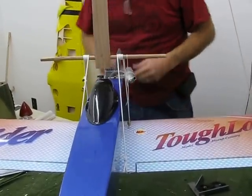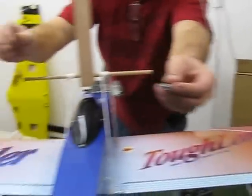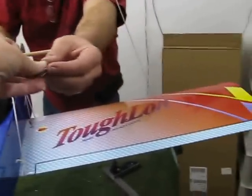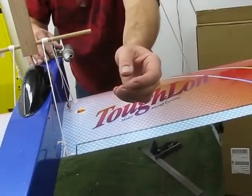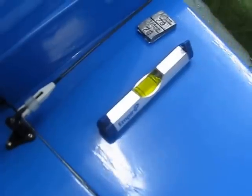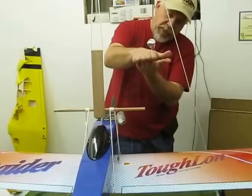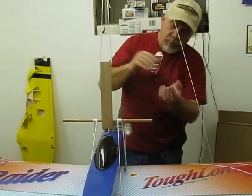What we're going to do is have my wife put a level on the tail, and then we're going to add a couple of chunks of weight to the tail to simulate it being tail heavy. When you do this, you also have to remember that the little bubble level you've got on there is actually going to add weight to the tail. I've seen people put a camera tripod next to the tail, put a straight edge on it with a level, and do it off that.